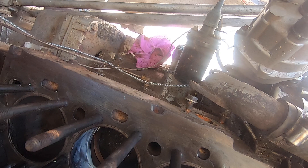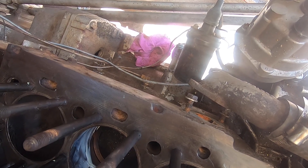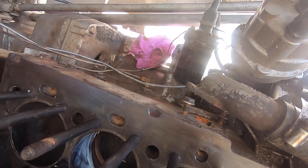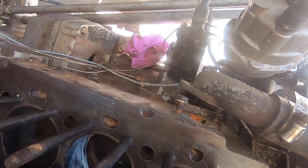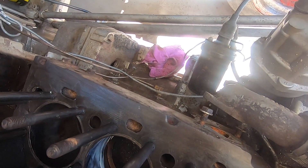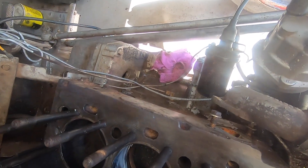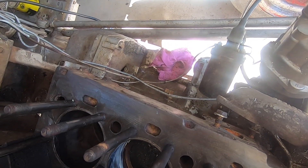The only good thing is I do have the exhaust disconnected. When it's connected you have extremely hot gases coming out when you have to get your head down there to try to see where that little timing mark is. I'm going to try to use a yellow paint marker so maybe I can see it, and try to actually check the timing - because all I've been able to determine is that it's retarded a little bit, since I just cannot get in there very well.